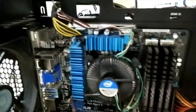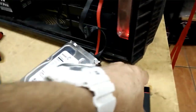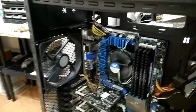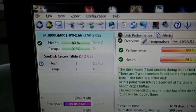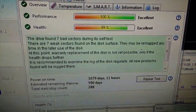It's been running much cooler, which is gonna help. Some of the other upgrades we're gonna be doing: we're gonna be changing this hard drive and going with an SSD drive. The customer wants better performance — he's got an excellent CPU, good RAM, but he does have a spinning drive. So that's one of the ways we're gonna improve performance. Aside from that, the hard drive is really not in great shape — it's at 89% and we found some bad sectors and weak sectors.